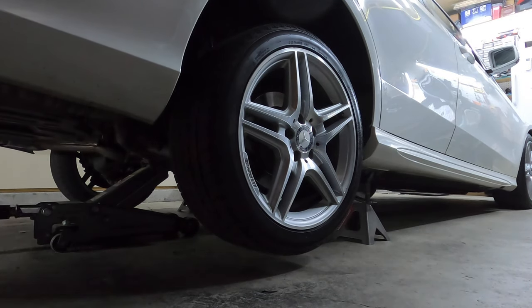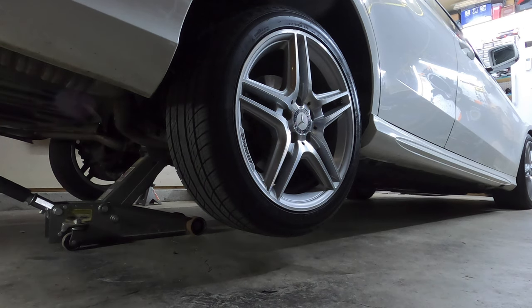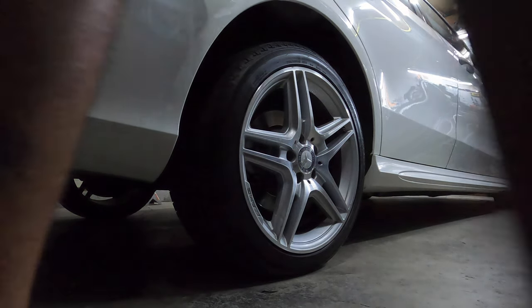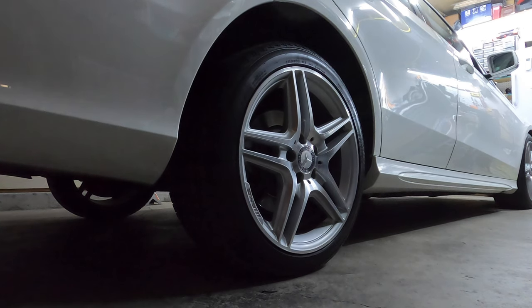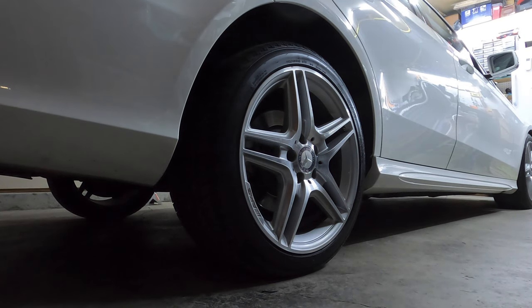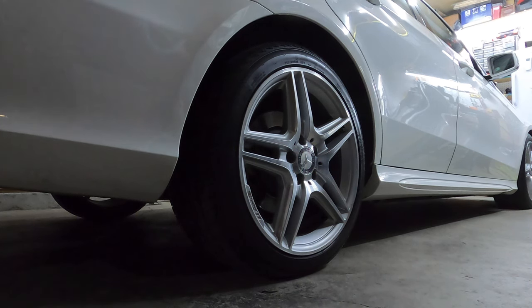So, let's get it up. See how she looking. Huh. Yeah, but, oh, hold on. I mean, we took off 2 inches from the spring. But I wonder if, because the spring actually went up in the plastic piece, and the strut piece is sitting on the bottom. Right. So that's probably the difference, is that this is being recessed up in there.